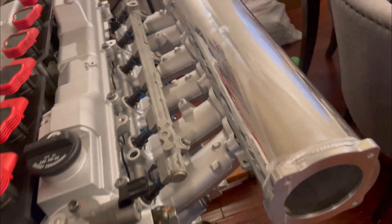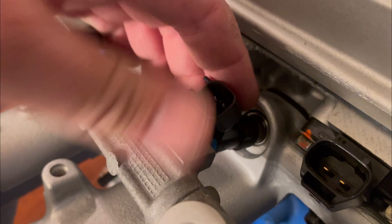Tonight I'm going to go ahead and weld on an AN bung. We won't be perfectly good yet though — I have to slightly shorten these little black spacers, there are three of them. If you look at my injector, I can pull it up into the drilled hole in the fuel rail and you can see the ring starts to come out of the fuel injector adapter down there. There's just a little too much movement up and down. Had I foreseen that I would have drilled the holes less deep, but I had no good way of knowing.